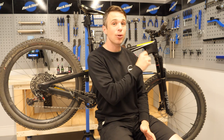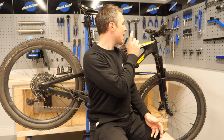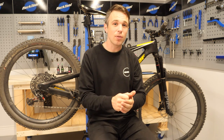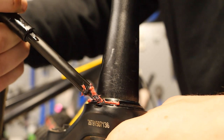If you're struggling to locate exactly where the noise is coming from, I'm going to give this bike a full once over. I ride this bike a lot and I haven't had all the bits apart in quite a while, although it is running pretty quiet, but I think it should be a fair representation of the kind of things you'd find at home. In the headset, the reason it can cause noises and that cracking, creaking sound is often because there are granules of dirt trapped between two interfaces that just get crushed over and over again and can cause a bloody racket. We're going to take apart this headset, clean it all down and give it some fresh grease.